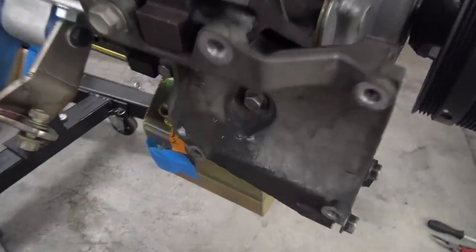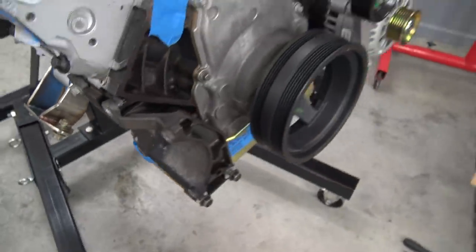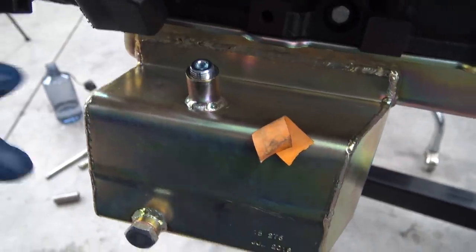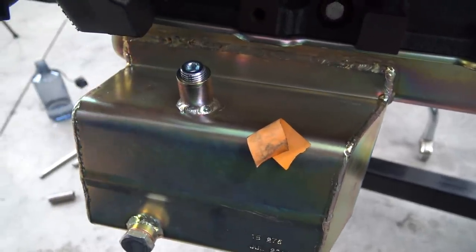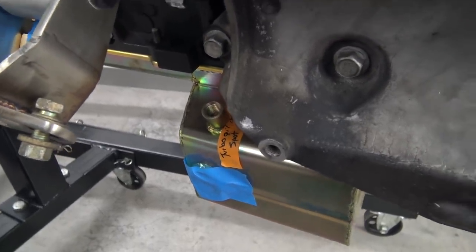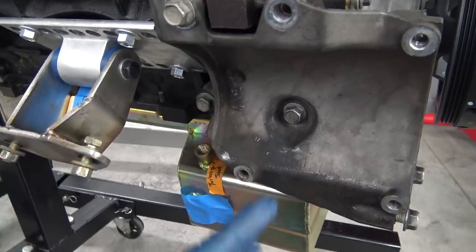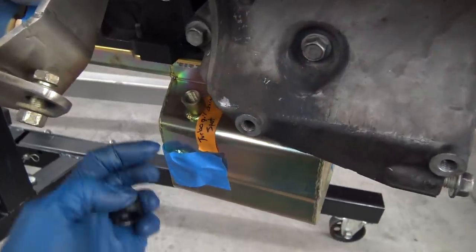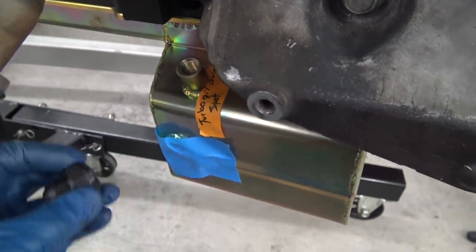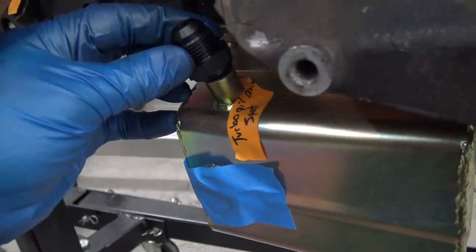This pan offers two dipstick locations — one on the passenger side and one on the driver's side. The driver's side location will be perfect for our threaded-in dipstick that we'll set up later. On the passenger side, I think this will be ideal for our turbo drain because the turbo is going to be located on the passenger side of the engine compartment. We've got our engine mount and the AC compressor in the way, but we should be able to sneak it right behind the AC compressor. I've got this steel weldable 10AN fitting, and my goal is to get that right on there.